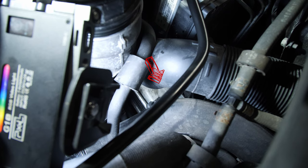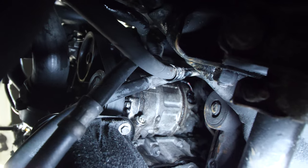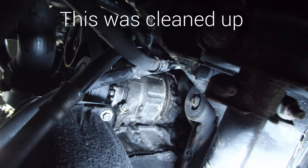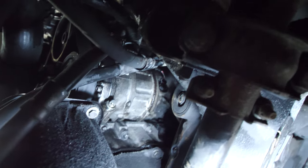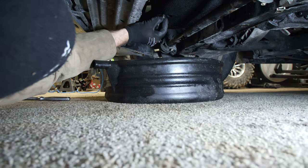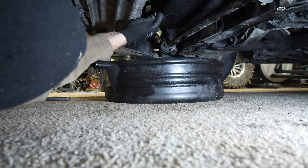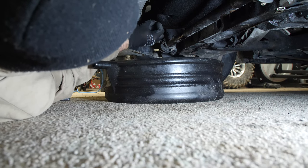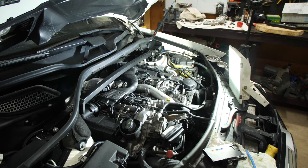Here's a quick shot from above looking down — you can see that little painted cross member that usually has oil on it. From the bottom looking up, the power steering pump is just above that pulley and it's usually covered in oil. What I did was pull the drain bolt and also open the oil filter housing just a little bit, letting the oil drain all night — at least a solid eight hours — trying to get all the oil out.